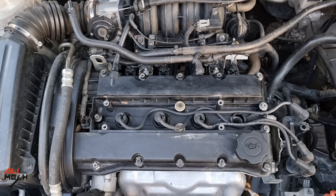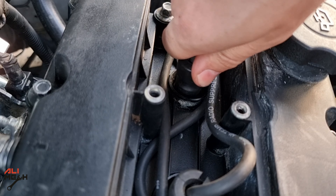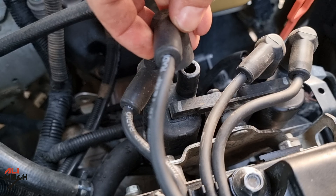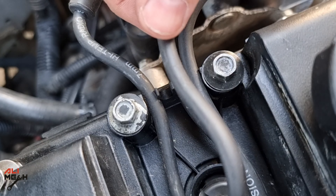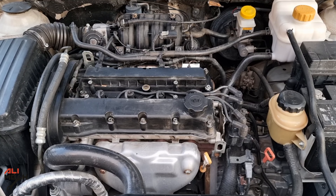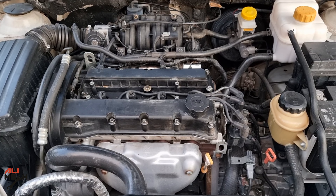Alright, we're gonna put the spark plug wire back and start the engine. If you had a broken spark plug wire, here's how to fix it. But remember to check the ohms first — if it was more than 800 ohms per foot, it's better to replace it than to fix it. And now the engine is back to normal idling.